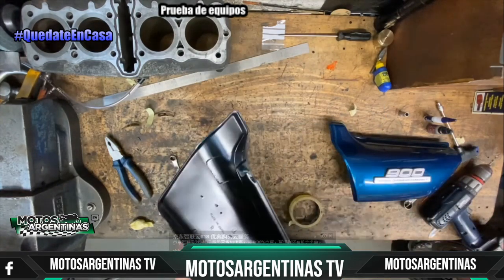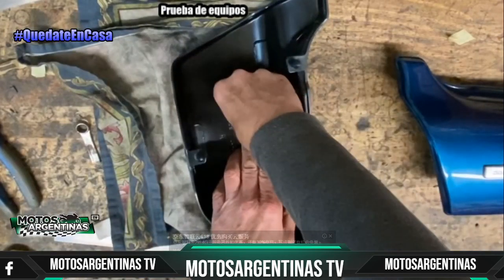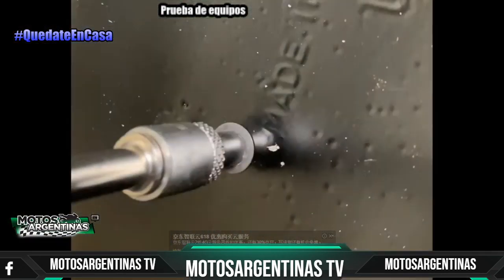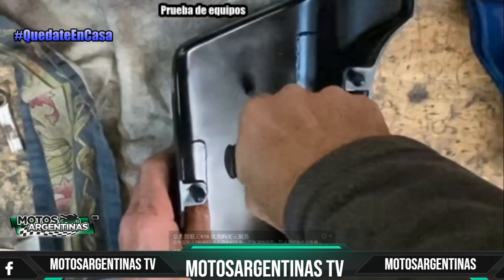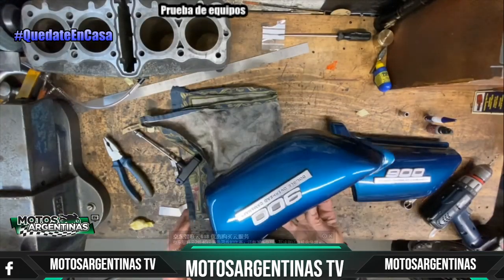The next thing to do is turn the panel over, put it on a piece of cloth so you don't damage the surface of the paint, to press on the little catches, the little washers with the serrated edges that prevent the badges from falling off. And I found the easiest way to do this is to use a little tiny socket on a push bar, so you can put the washer on with your hand, press it down nice and firm, and it holds the badge on really secure, and it's not going to fall off.